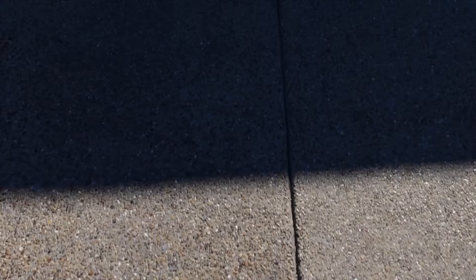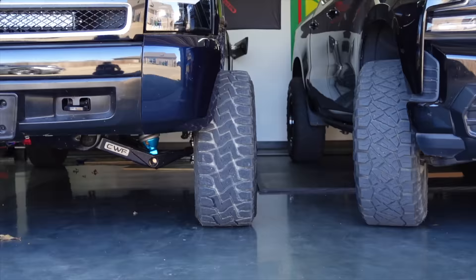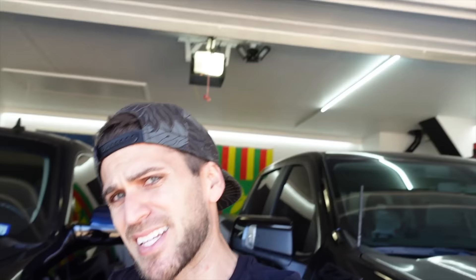The alignment turned out pretty good. After about a week I'm going to go ahead and remeasure all the measurements from camber to caster to toe, just to make sure we're still good once everything has settled in. For my own sanity I marked the alignment cams on both sides where it currently sits, just in case it does get knocked out a little. We're going to eventually throw our Dirt King locking alignment pins back in there once I know we are set to go.